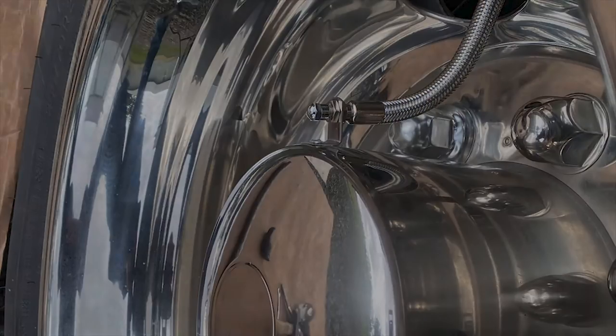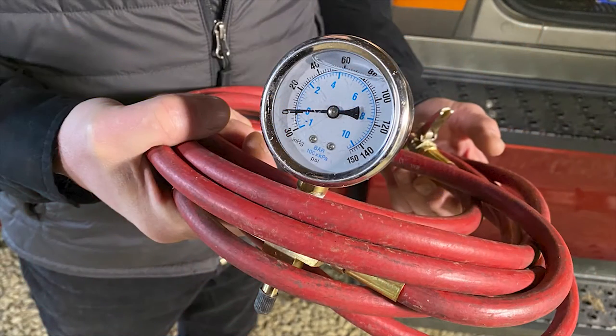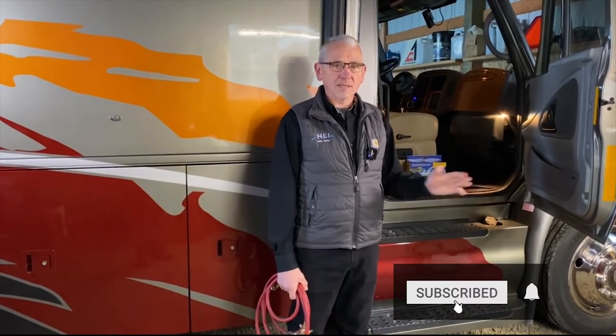We've got that job done. I really like the idea that we've got a longer stud with more threads for the nuts to hold on the wheel covers, so we don't have to worry about that. We've got the valve stem extensions on so we can air up the tires easily. We're also going to install a tire monitoring system that keeps track of tire temperature and air pressure as you're traveling, along with an emergency fix for a flat if you were to get one on the road. Thanks for watching.